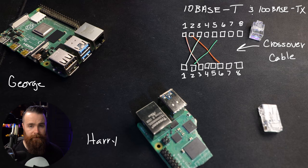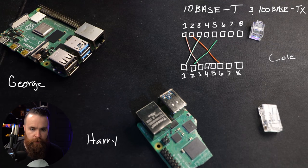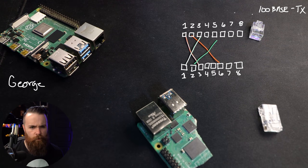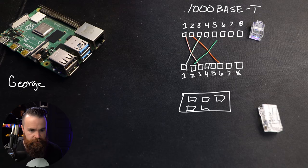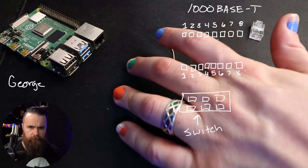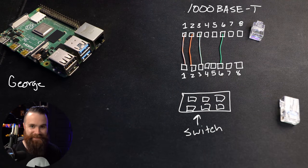There's something special they do now. Let's stop talking about the old stuff and talk about what we have now — the cable we're making in this video: Cat 5E, the 1000BASE-T. Things are about to heat up because we're not dealing with just four wires — we're dealing with eight copper wires. Let me put our switch back in there, because I do want to focus on the straight-through cable first. Now with 1000BASE-T, our gigabit ethernet Cat 5E, we know we have eight copper wires.